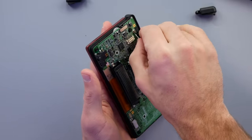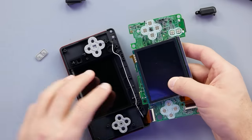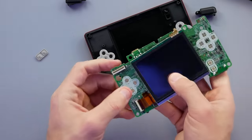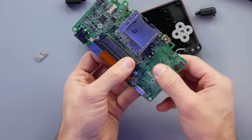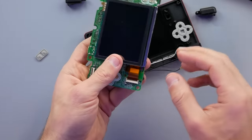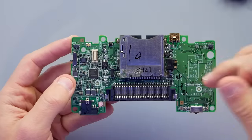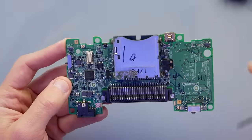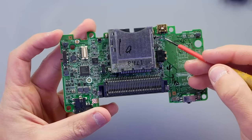With that done, we flip the board up — looks like some buttons came with it — and unhook the ribbon cable from the top screen. The board comes free. I remove the bottom screen quickly to check for water damage underneath; there is none, and the board itself is dry. Back when I worked on DS Lites it was almost a 50/50 shot on water damage. A lot of times when you see that flashing charging light, there's a fuse that can act up and break the power circuit — there are a couple of fuses that can cause this.